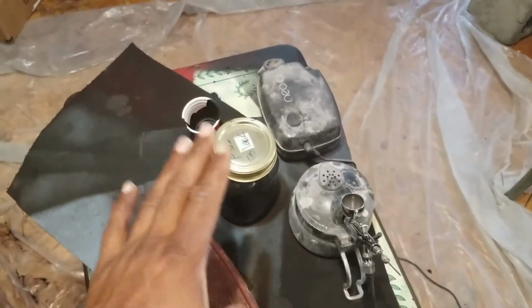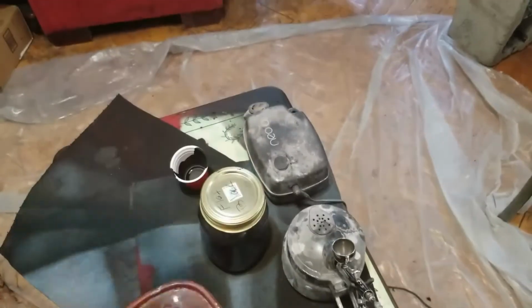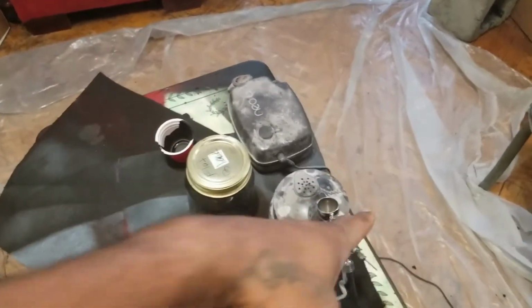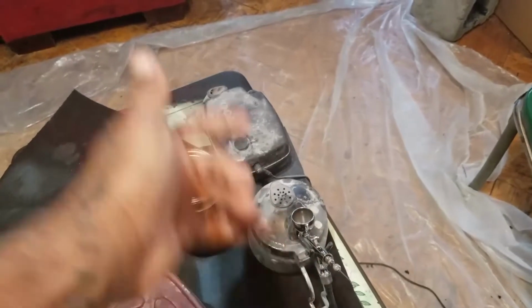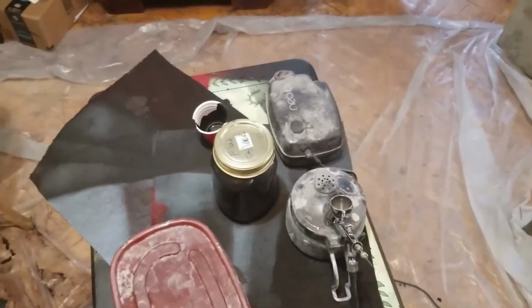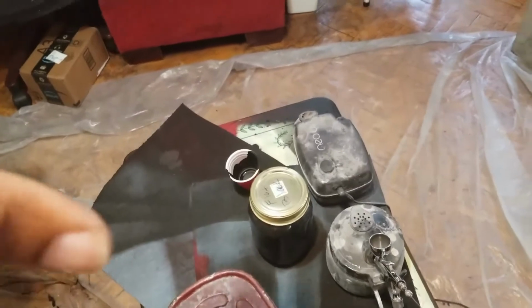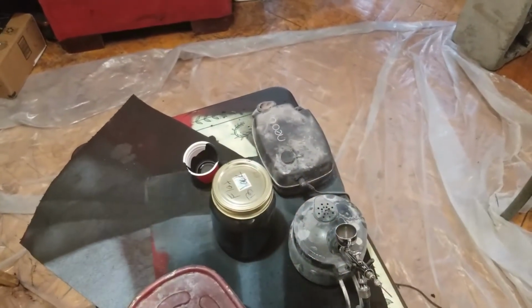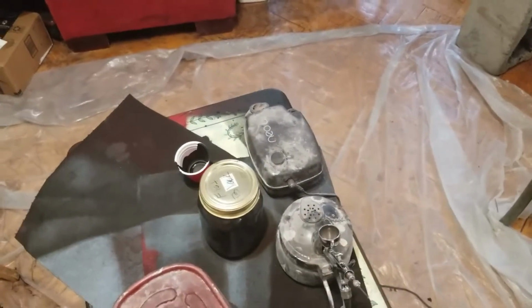I only recommend that you heat this up a little bit. Run some hot water and let this sit in there for 5 to 10 minutes to heat up the paint before you start to run it through your airbrush. This will help it get through the airbrush without drying, okay? Because you'll have the dry paint hit the piece, and you don't want that.